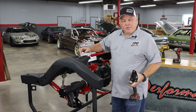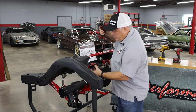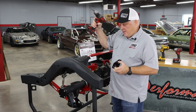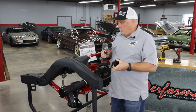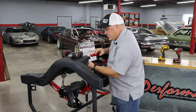The existing frame has two holes for the factory shock. We ask you to drill a third hole for additional reinforcement — you can see the three holes here. This goes here with the notch facing outward and rearward, using a 5/16ths drill, and we're just going to go up through and drill the 5/16ths hole. Then the bracket fits in just like this.